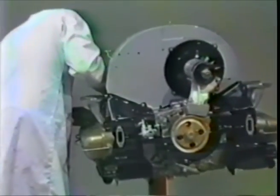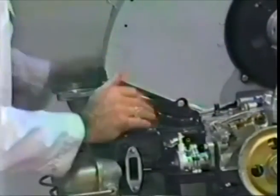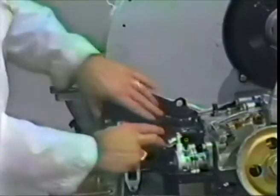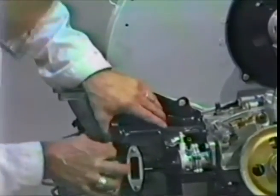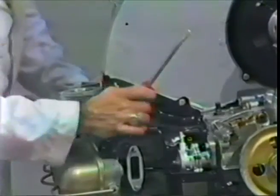Even if it does, the side horizontal pieces go on top of this. And you put it on, get it aligned, whack it down there a little bit, get it over the cylinder shrouds in the front, like that. Get it over the cylinder shrouds in the rear, like that. And then usually our example bolt, okay, it will go down. You sometimes have to help it out. But it will usually, there it is, usually go down like that.